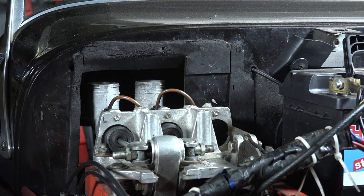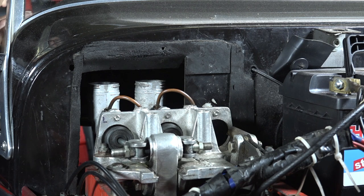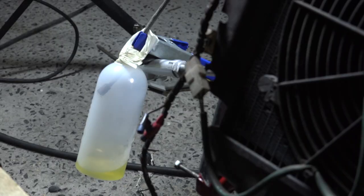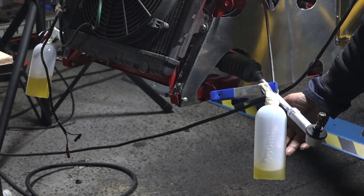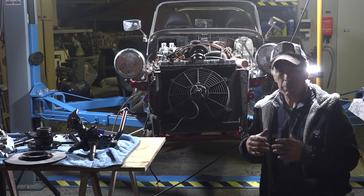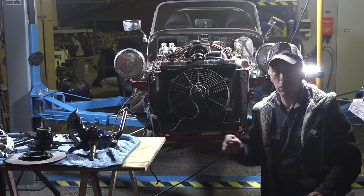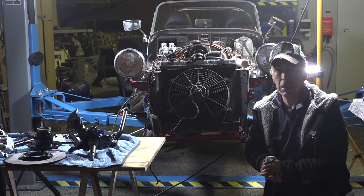The next thing is to push the brake pedal a few times so we can see the liquid disappearing. The bottle is filled up quite nicely in the front and also in the back — the brake fluid inside is throw-away, there's nothing you can do with it anymore. We've flushed all the brake pipes and confirmed the master brake cylinders are working and not leaking. I was quite happy about that — I didn't have to recondition them because they still looked very good.